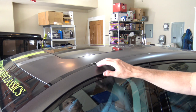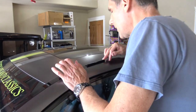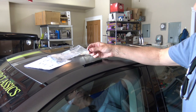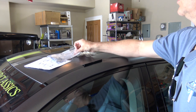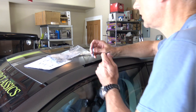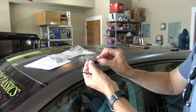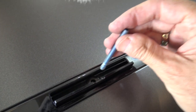Here we are on the driver's side. This is a fixed point installation, so you just need to flip up your little cover — there's a spot to mount on. The first thing you have to do is remove the little rubber plug from the hole. Put that in a bag for safekeeping in case you need it later. Then take one of the posts — there are four — and on one end there's a little sleeve so it can only go in so far. Just thread that in; it uses a 3mm hex tool to tighten.